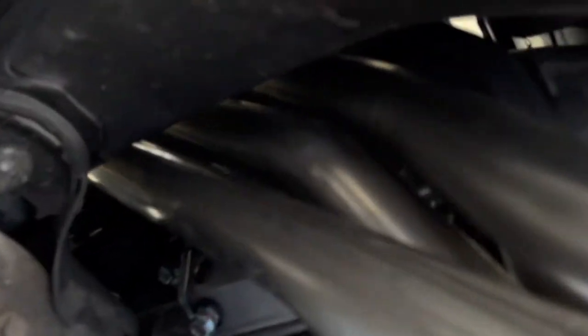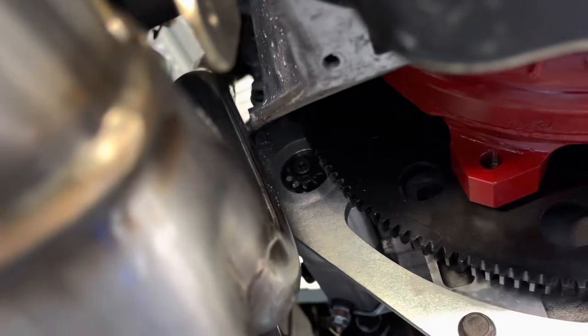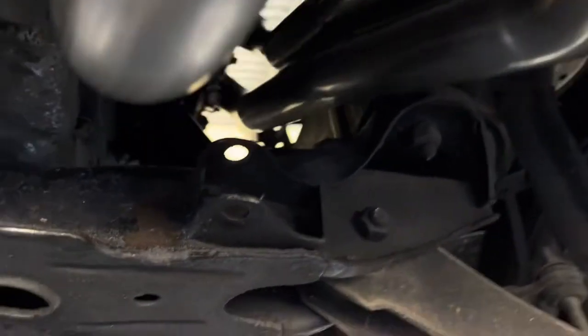You can see, it does clear, but for whatever reason, it wasn't going to happen unless we cut these little wings off it before the inspection plate. I just had two little threads on each side, and I'm pretty sure that's pretty normal for a Turbo 350 or 400. But I don't know why the headers didn't fit without us cutting it off. There's nothing in the instructions that says, hey, cut your gearbox up. But this I got in there with the saw. Looks pretty nice.